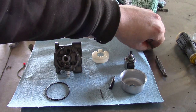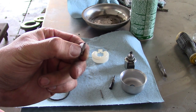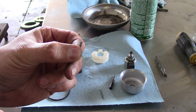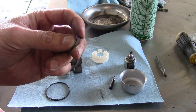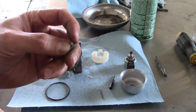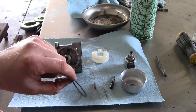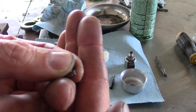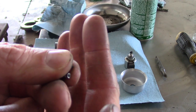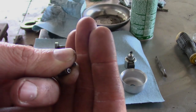Didn't really find anything wrong with it. There are a few things I'm not in love with — the little rubber tip on this needle here isn't the greatest. It's starting to kind of pucker away from the metal body there, and the bowl gasket's not great. But I think we can make it work. Well, I shouldn't have even touched it — I broke the rubber part off the end of that needle. So we're going to have to replace that.